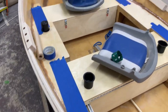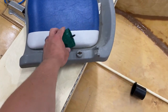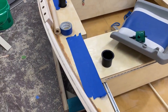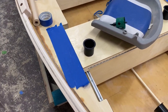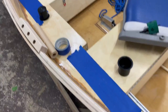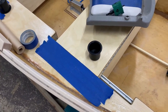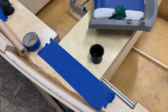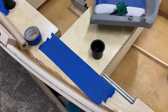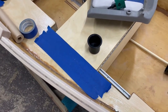I'm going to start adding the flotation foam. I've got areas masked off with tape, and I have a location picked out. The hole saw bit is for the cup holders — there's no drain in the bottom, and I'll seal them up when I put them down so water can't get in. I taped a large area because I'll make a funnel out of craft paper or paint masking. I've never used flotation foam before — it's a two-part foam that you pour in and it expands. Just taking precautions so I don't make a mess.